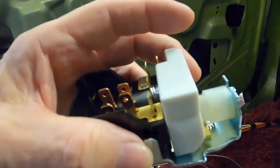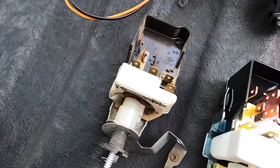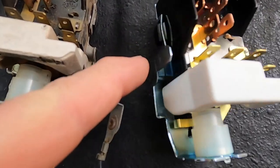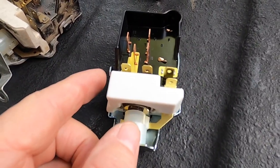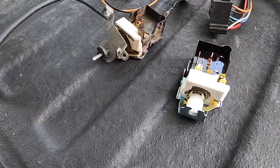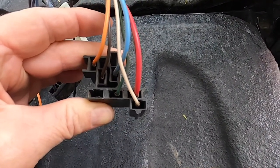Now that we know how the newer-style light switch works and why they're using a nine-pin, we can compare that to the way they did it on the original equipment. Here's the old original equipment headlight switch and the new one. You can see the side lug for the ground — the old style did not have that. So by American Auto Wire using the newer-style nine-pin and jumping the ground over, it makes for a cleaner install. There are also quite a few fewer pins on the old original equipment, and they didn't use all the slots on the old wiring.